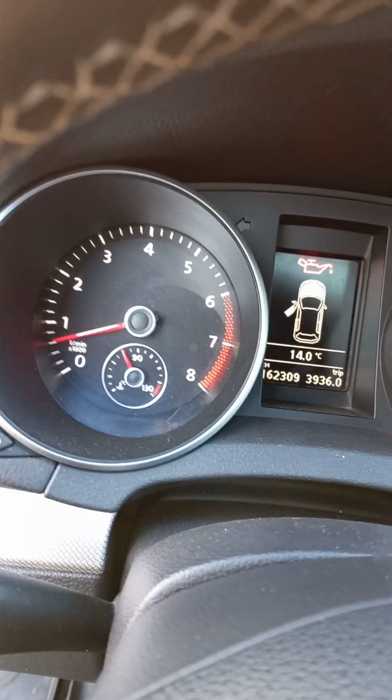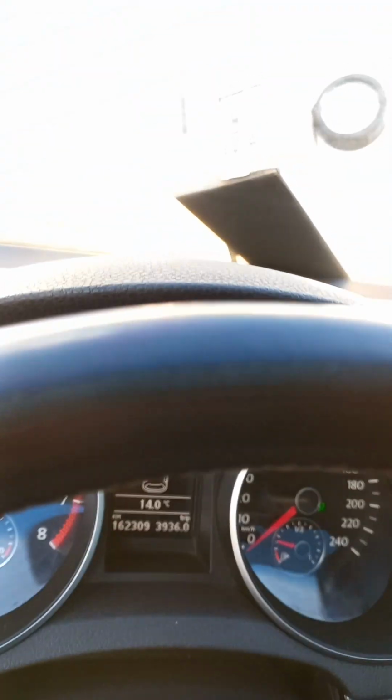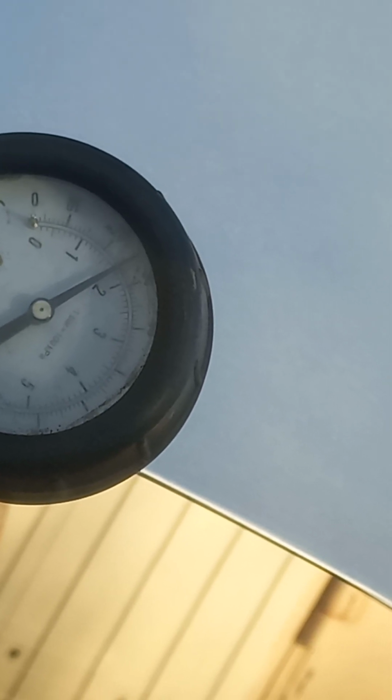So, 80 degrees. From ELSA we can find out that the manual says that at 80 degrees and 2000 RPM the pressure should be at least 2 bar. So, let's do 2000. I get 2000 RPM and the pressure is 1.7 bar. It is not enough, but not critical, and I am sure that if I use good quality oil, the pressure will be fine.